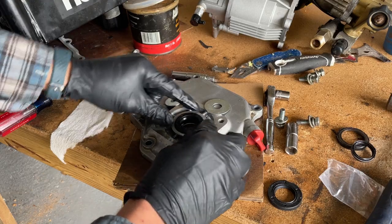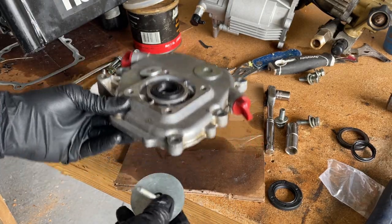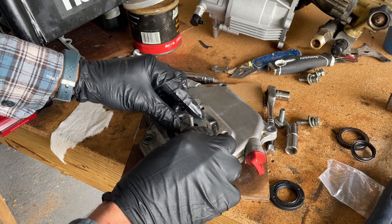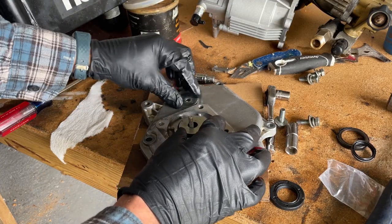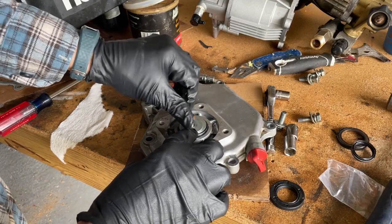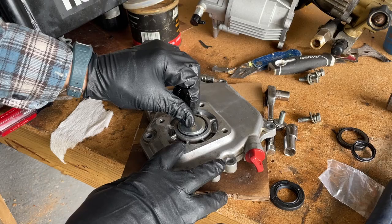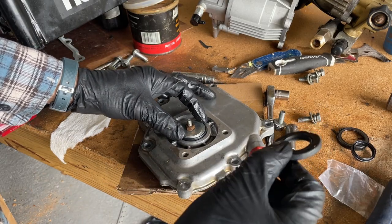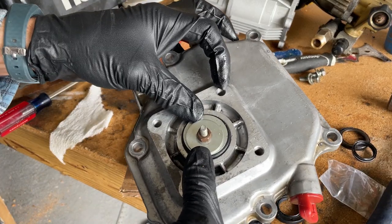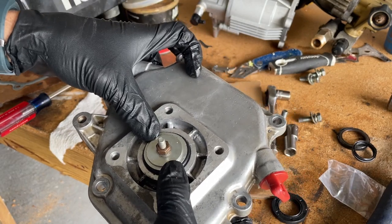What I'm going to do is place the seal like this, then put a bolt and washer underneath on the bottom side. Come up through here, then place a washer that's close to the external diameter of the oil seal, and a smaller one so the nut actually catches. As I tighten this up, it's going to hold on the bearing side and pull that oil seal down into the recess. I must confess I already screwed up once and recessed it too far — so stop and check every now and then, because if you recess it too far it will run into the bearing and then your crankshaft will spin but the bearing will not, which could cause serious issues.